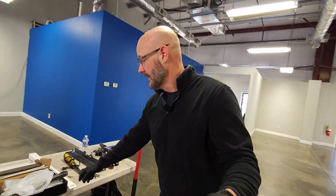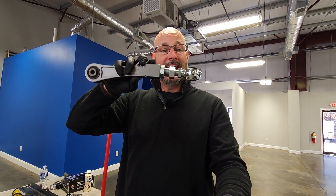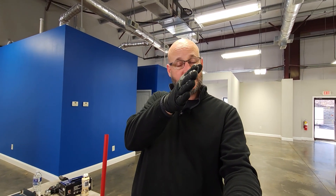The correction is to replace the camber arm with an adjustable camber arm. It allows you to adjust the top of the tire in and out, making it perpendicular to the ground at your normal ride height instead of having negative camber. You can never make it perfect with independent rear suspension at every setting, but you want it adjusted so that at your low vehicle setting, all of the tread is even with the ground. For those wondering why Tesla doesn't have a factory correction for this — I don't know, I've wondered the same thing, but they don't.